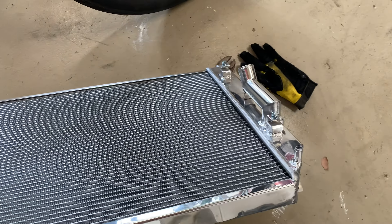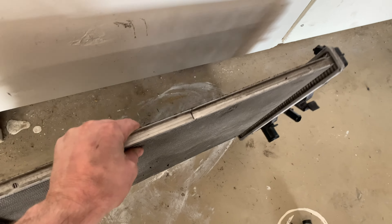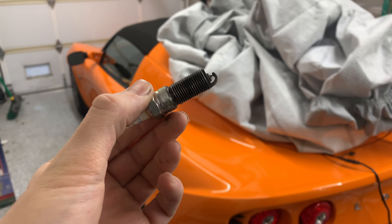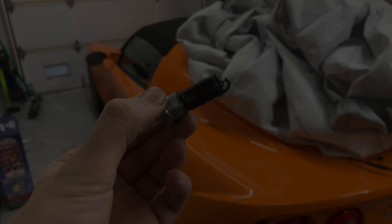I've got a check engine light flashing. Getting off the track. Coolant temperature is fine, but cylinder 3 misfire detected — so I do have a misfire. I've got to chase that misfire down. Long story short, this is the engine failure I experienced on the racetrack. Coolant temperatures were getting up to over 230 degrees. I wasn't seeing that while on the track because it cools down quickly when I cruise off. The engine detonated and closed up the gap on the plug. I compression tested and put new plugs in, and somehow everything is fine now.